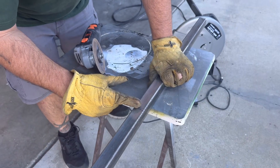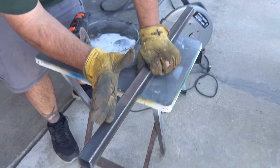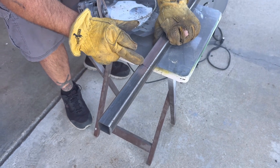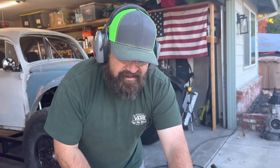What I'm going to do is cut a notch in here — a little pie cut — and that's right where I want it to bend. Then I'll bend it over and weld that over and close again. All right, let's go.